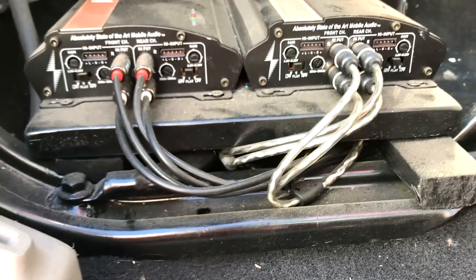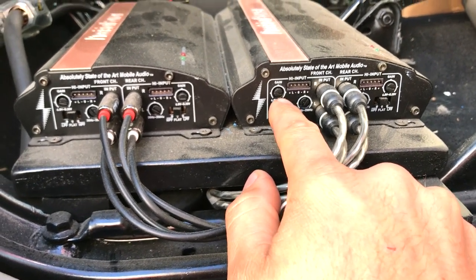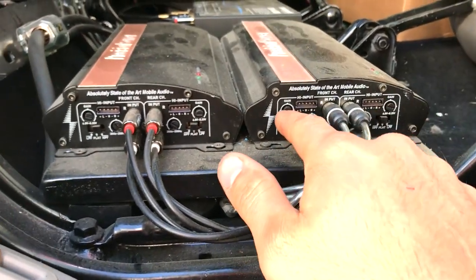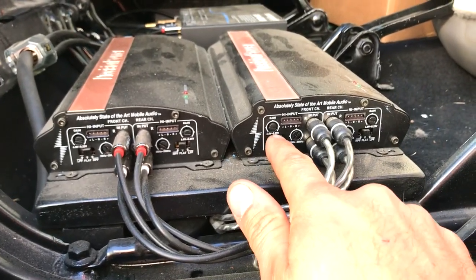Check this out. If you're looking at the amplifier, what do you see right here? 6 volts to 0.25 volts. So if you're getting voltage gain from your head unit at 0.5V, you shrink the gain knob almost all the way down to 0.5 — you're good down to 0.2 volts. That's what people don't understand. They think the gain is a volume knob, they crank it, and they get a bunch of distortion. They don't know why their voice coils pop after a while.